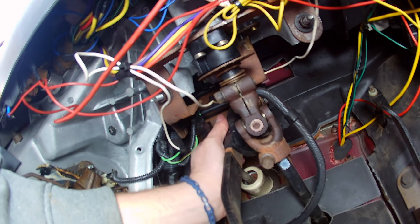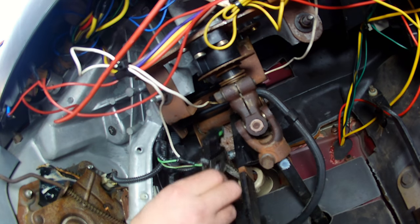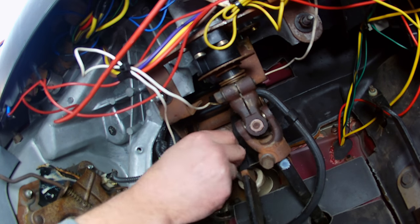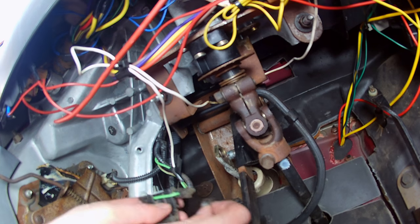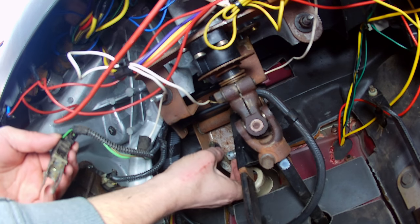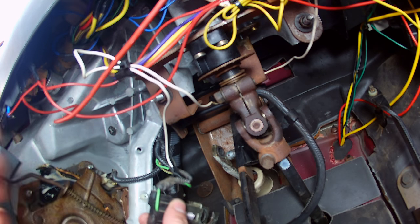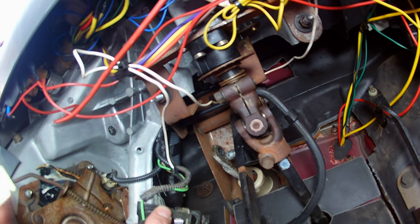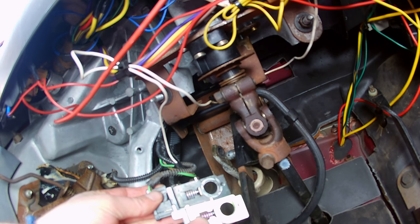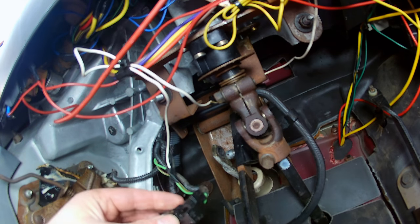Kind of wiggle this to give you enough clearance. The brake pedal will then go limp, and then you can pull this off here. You're going to have this rubber insert right there — don't lose that. The rod that goes through everything here just goes to the brake booster. There's a rod that points off the left-hand side of the brake pedal, and keep in mind, you've got to have the correct orientation to put the new switch in place. So make sure it looks the same and it's going in the same direction. Next step, pull off the electrical, and then just put the new one in in the exact same order.